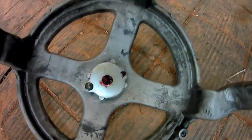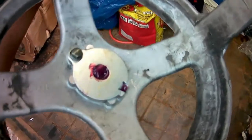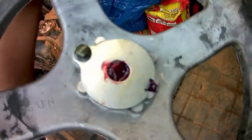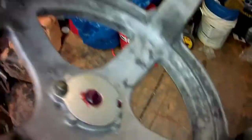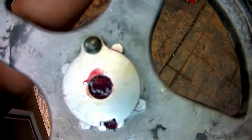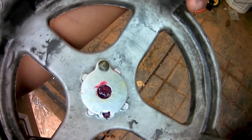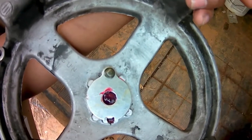Good afternoon everybody. Getting this bearing out really kicked my butt this week — it was really hard and I think I overdid it and went about it wrong from the start. I finally got it out, put the new one in, got the new seal, new bearing, and a new pressure plate in. My mistake was pulling the inside of the bearing out along with the roller, because the bearing puller I had requires the inner bearing to still be intact.